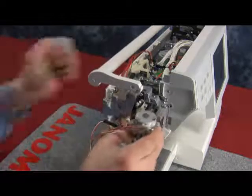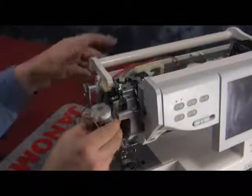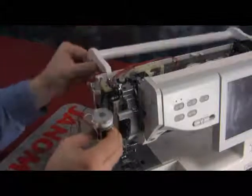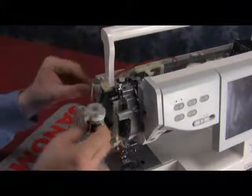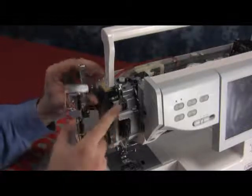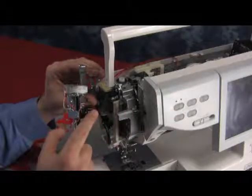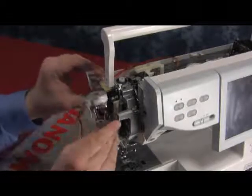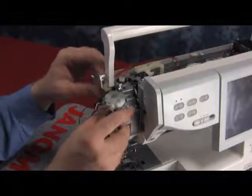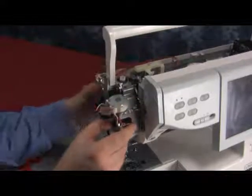When lining the threader motor up, you must look at three different things. The first is at the top of the bracket, you must make sure that the handle will fit into the top. Not only that, but on the left side of the threader motor bracket, it must fit into the top of the rear cover. And you have the white little clip at the top of your threader shaft that must go inside between the two black blocks. Start to put the threader motor bracket on and line those three items up and hold it there gently.